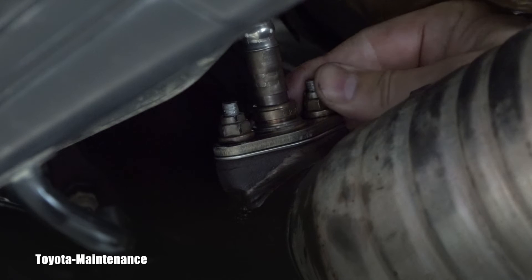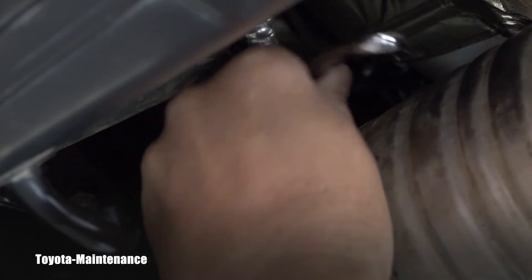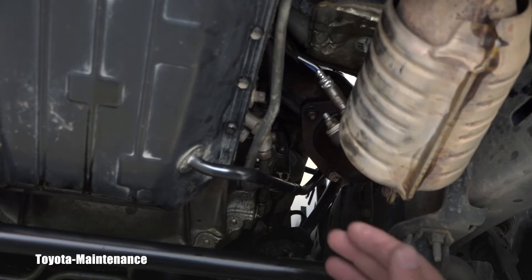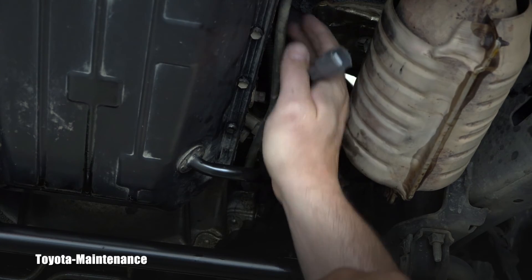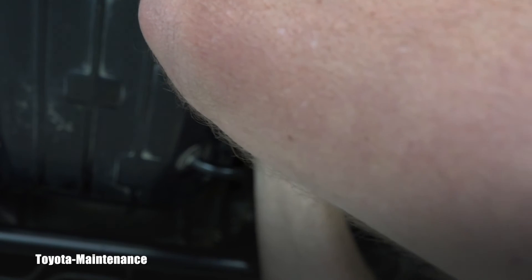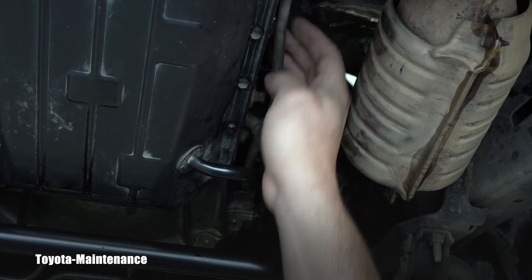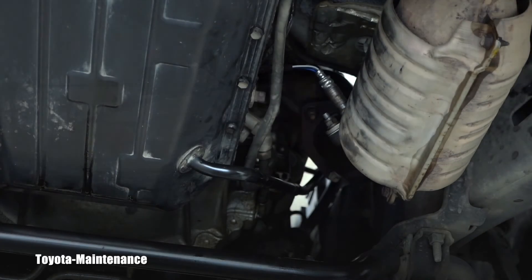I will gradually go right then left, right then left, to make that gasket go down evenly. There's not much space here but both nuts are tight enough. Now it's time to connect the electrical connector — just pay attention to the detail that everything goes together nicely, click, and attach it to that little hanger so it's not freely flying around. This is perfect and that's done.